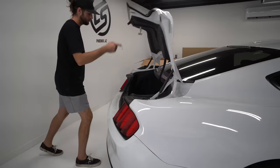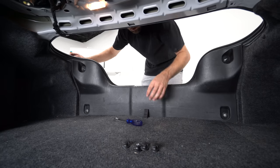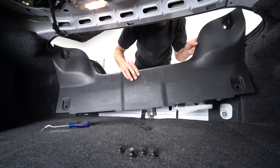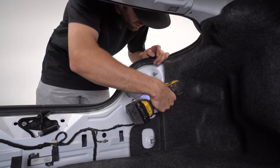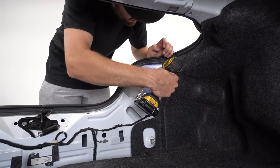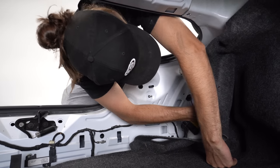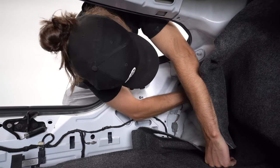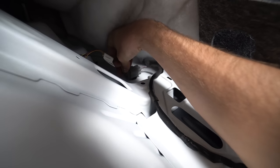Pop the trunk. There are four plastic nuts made to turn by hand — they blend in with the interior. Rotate those lefty loosey and pull from one side, then the other, and pull up on the plastic piece to remove the entire trim piece. Up in the corner there are some plastic clips you can use a pry tool with — I have a link in the description. There are three studs on each taillight; take the nut off each one. One is tucked down behind the interior piece — just peel it back a little. There's also a clip for the taillight electrical. Pull the entire taillight out; here's a view of the inside to get to that third stud and the plug for the wires.